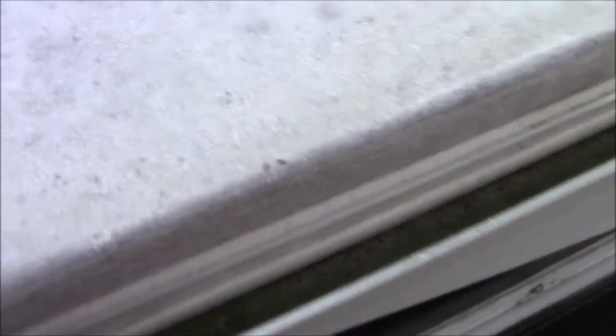You can see how distressed the roof is. I'm going to try to get the camera in here - see those little tiny fractures? That means this roof has failed. Some people call that spider-webbing; to me it looks like an eggshell when you crack a hard-boiled egg. It doesn't look like there's anything on the edge right here at all.